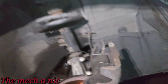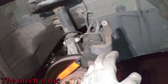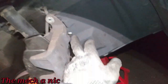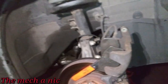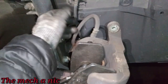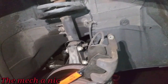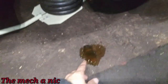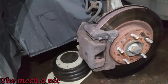Using my brake tool, with the bleed valve open, the piston went in. But as soon as I closed the valve, the piston didn't want to go in anymore. I did the same test on the other side — I want to confirm since the calipers are the most expensive part. If it's the same result, I'm going to start with replacing these rubber hoses, which are likely the original hoses from Nissan. It's unlikely a restriction would affect both sides simultaneously, but we have to start somewhere. And yes — on the other side, the piston was hard to compress until I opened the bleed valve, then it went in without a problem.